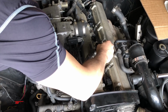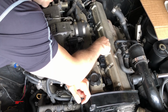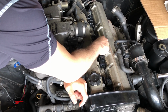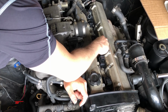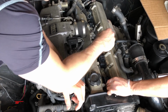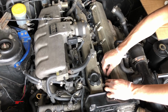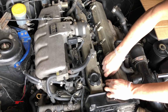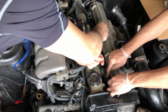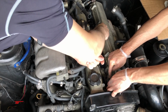So I'm going to get some of the other screws there that we put aside. And yeah, I'm not sure if Kenji mentioned it, but as you're pushing this down into position, you'll feel a little bit of resistance. The metal part of the coil doesn't really want to seat against the mating surface without some pressure, because there's that rubber part of the coil where it mates to the spark plug itself that kind of pushes back. So that's normal. For sure, yeah. And that's the boot, and that just insulates the connection between the spark plug and the end of the coil there, so that no moisture or dirt or anything comes into that critical area where we're trying to get as much electricity into the spark plug to fire the cylinder.